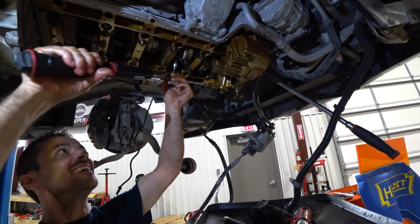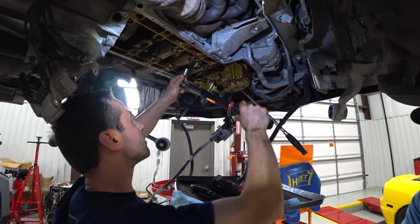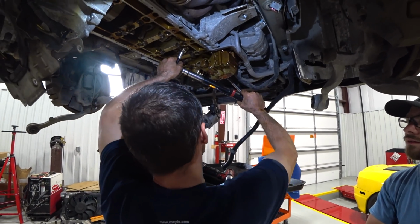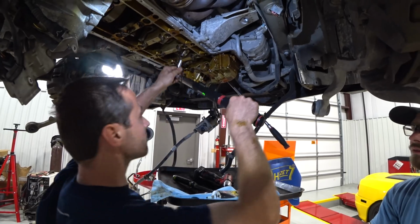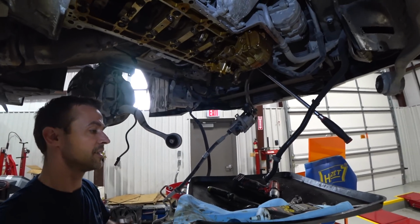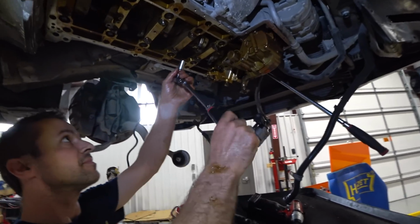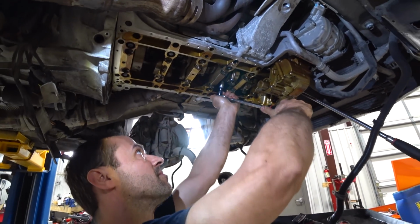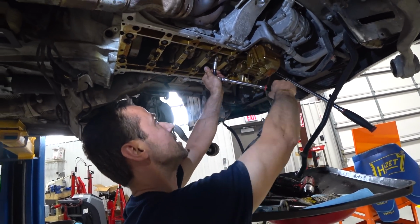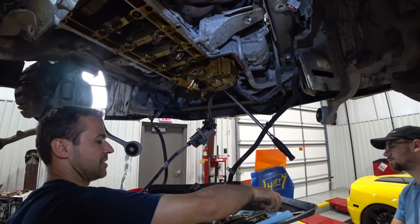Well, rocking out here, the tightening spec on this thing is 6 Newton meters, and then 20, and then 130, and with the Snap-on tech angle, which is amazing, you can see the lights lighting up as he gets closer to 130 degrees. Boom. That thing's amazing. We have to do this 3 times. The same sequence 3 times. 6, 20, 130, 6, 20, 130, 6, 20, 130. 10 times. So that makes it 30 times then. Yep. Nice. Okay, so it's loose, ready to do it again.